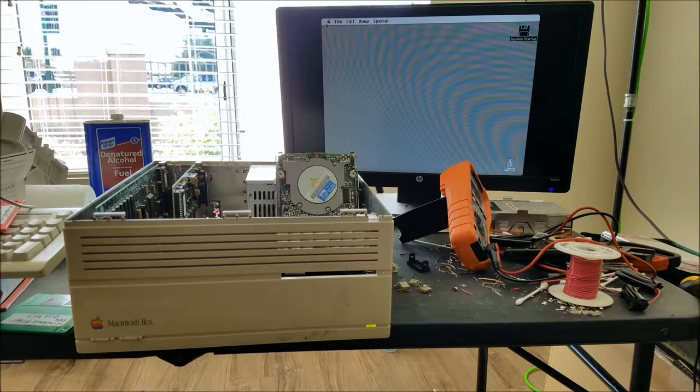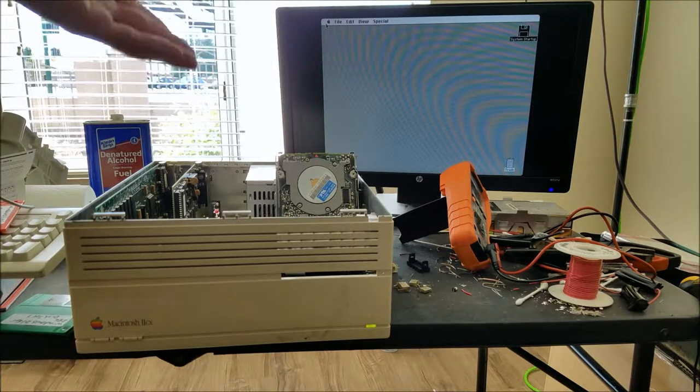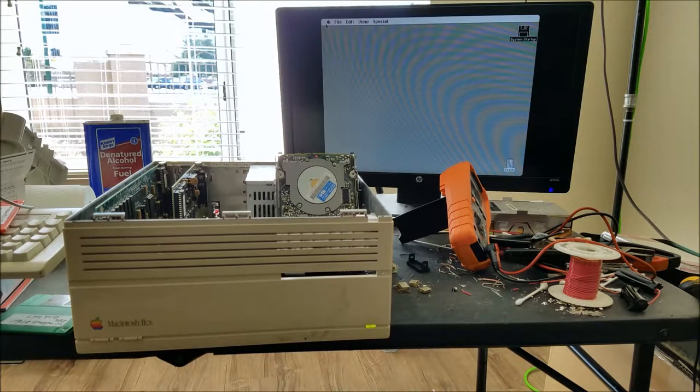When I powered up the LC - which I just got, ordered for this project to have spare parts - I tried to boot it off the same discs I was trying here, and it wouldn't boot. But when I booted it off the hard drive, which luckily still works in that one, it was able to read the discs but just wouldn't boot from them. So I copied the disc images from the PowerBook over to the LC, wrote the floppy on that, and it was bootable. I took that bootable floppy, put it in the floppy drive that was in here - still wouldn't boot - so I swapped the floppy drive over, and now, as you can see, we are booted.